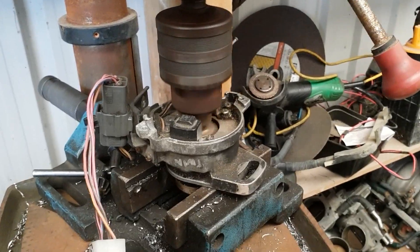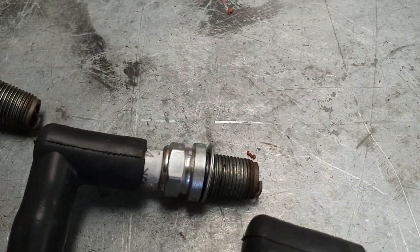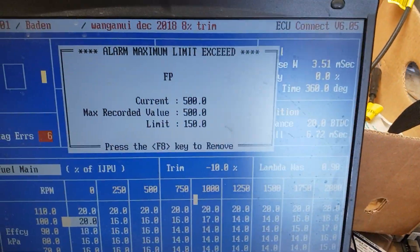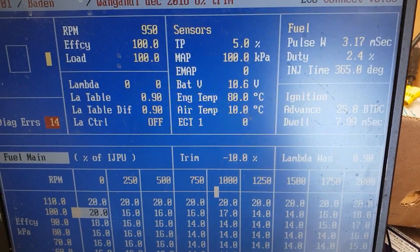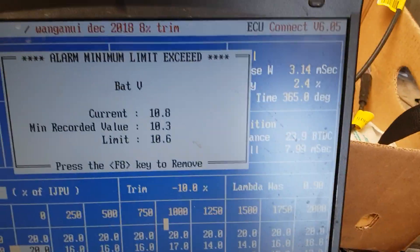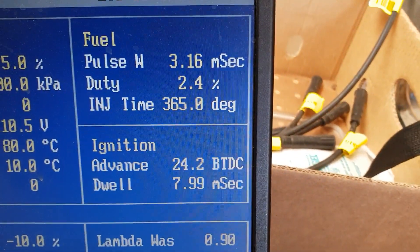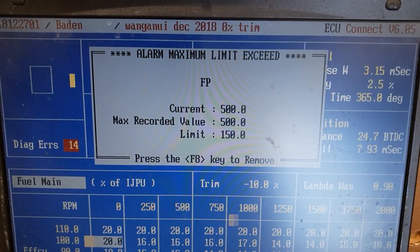If I actually turn this drill on - that works. We come over here, we've got spark happening and the injectors are working. I have got the ECU earth to the bench. Working at 100 kPa atmospheric pressure, it's defaulted an engine temp, air temp, and a TPS. My battery voltage is getting down because I'm running on my jump pack.